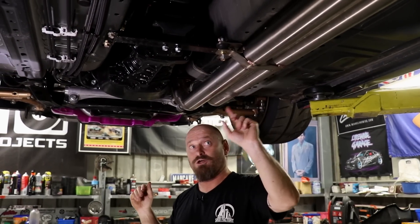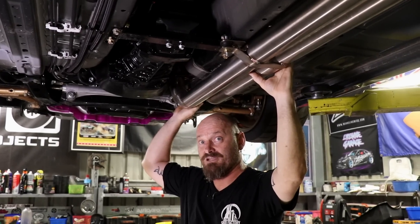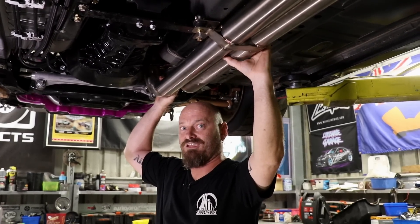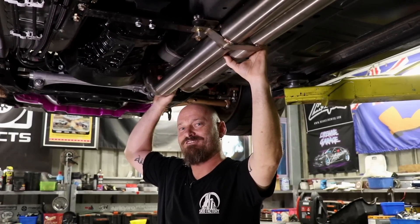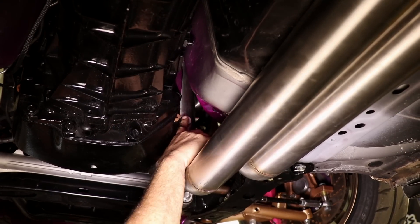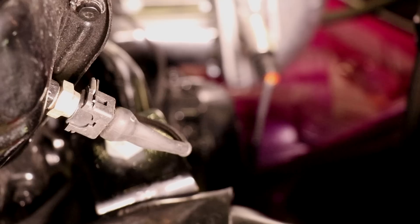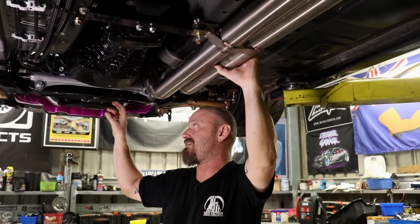Along with the exhaust system we've also fitted a wideband oxygen sensor kit from Haltech — a WB2. The engine is run by a Haltech Elite 2000 ECU. We never put the WB2 on it initially because it had bonnet-exit exhaust and having two oxygen sensors dangling off that really wasn't in the theme of the car at the time. Now that it's got the full exhaust, we can fit the oxygen sensors — the bungs are already there ready to go. The Haltech has a ton of sensors: oil temperature, fuel pressure, oil pressure — all the safety sensors that work really well with the Haltech to protect the engine in the event of a failure.